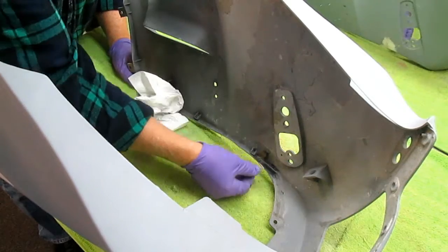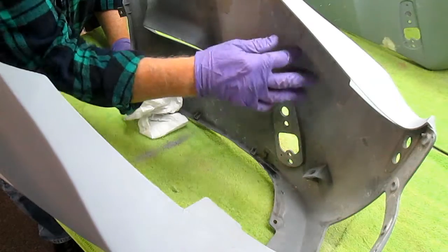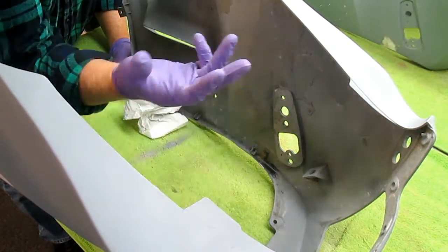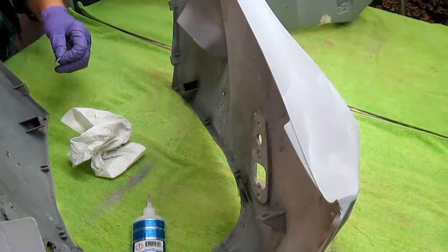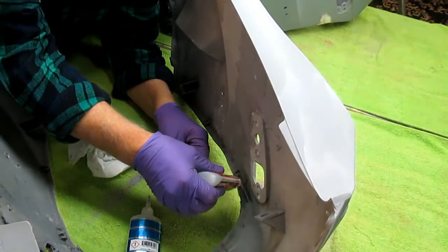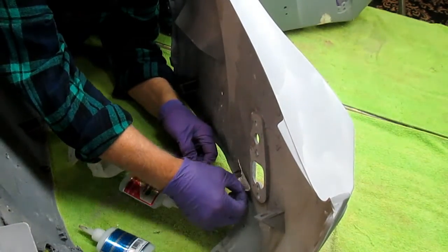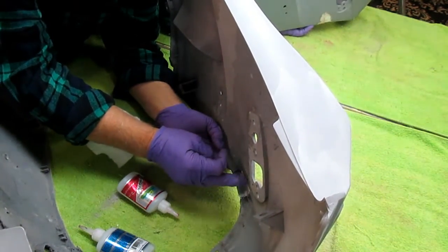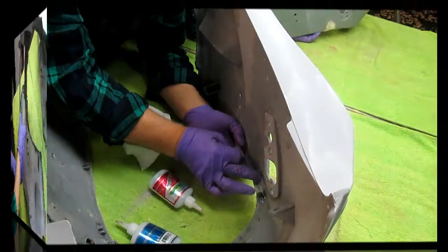And I'll cut a piece of reinforcing material, and what I'm seeing is that a lot of pieces on here, but there's body work almost everywhere. A lot of it looks like it was done with that mat. That's probably why this stuff cracked. So now, and this is awkward to work like this because I'm working inside a fairing, now I can spread some thick CA on this. Get my little patch of e-glass. Don't let your fingers stop walking around there or it's going to be a problem.